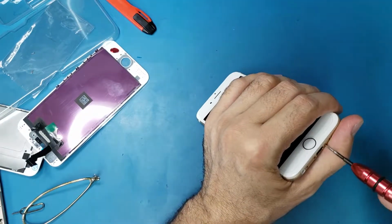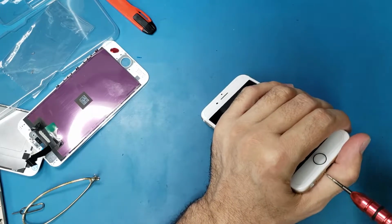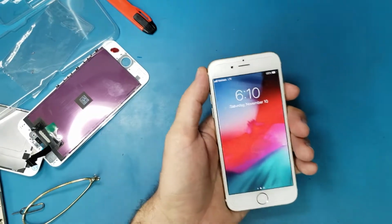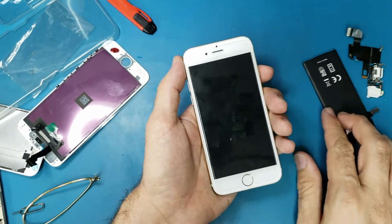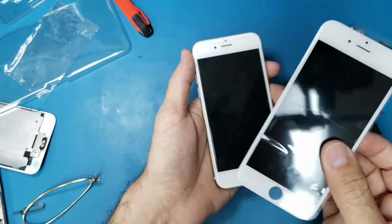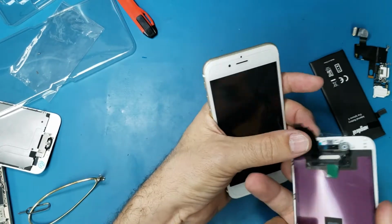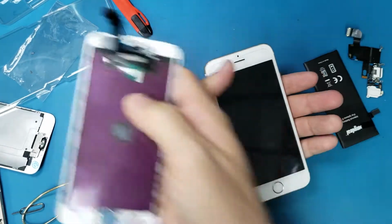Alright guys, thanks for watching, and as you see, we replaced all the parts that may possibly be the cause with this charging port. We replace the charging port, it doesn't solve the problem. We replace the battery, it doesn't solve the problem. And we go ahead and replace also the screen, even if it has nothing to do with the charging port, but because this one is water damaged, maybe sometimes some pins here got shorted and they cause the problem on the phone.